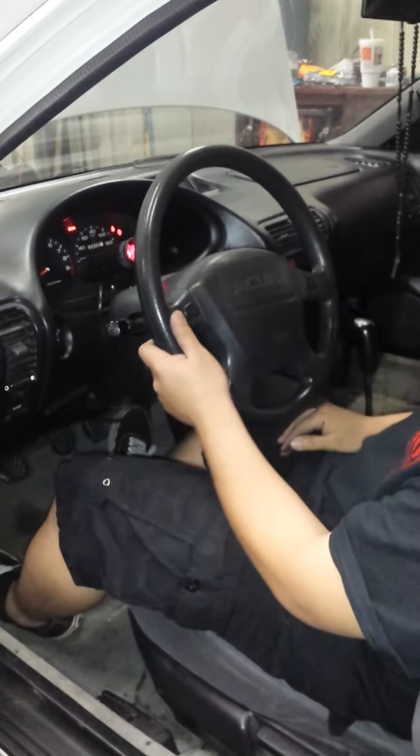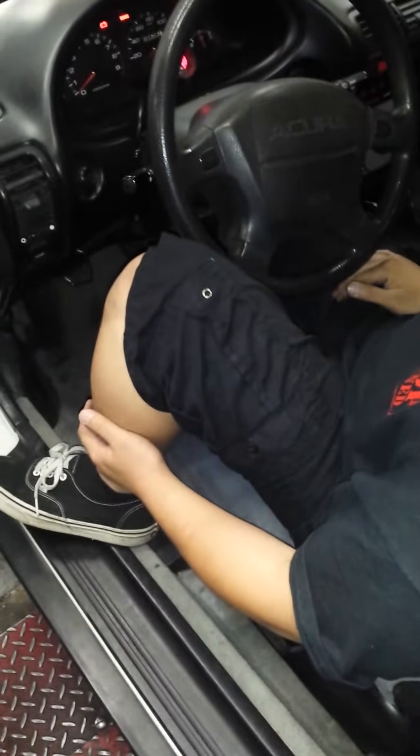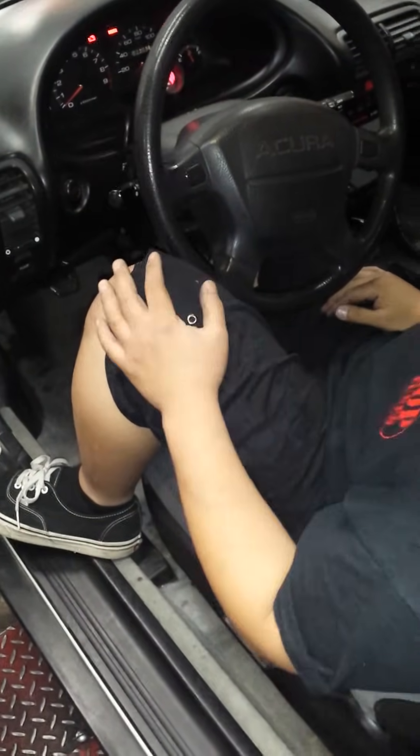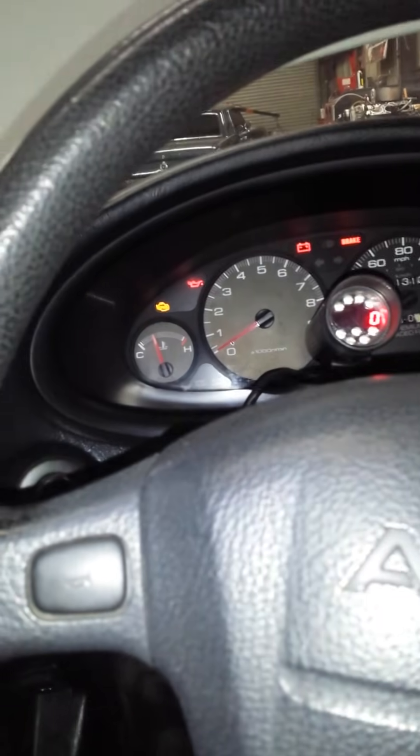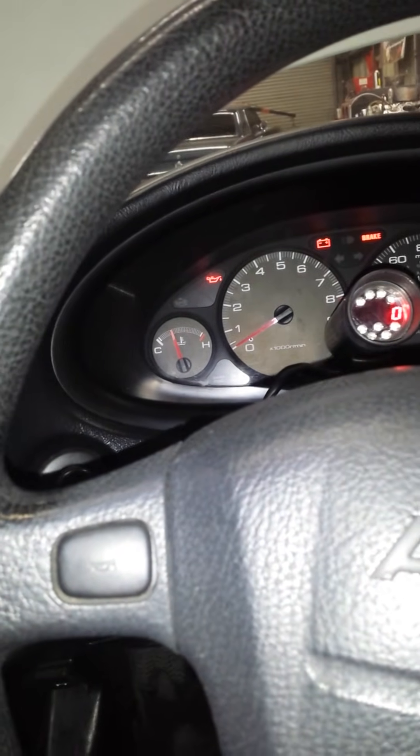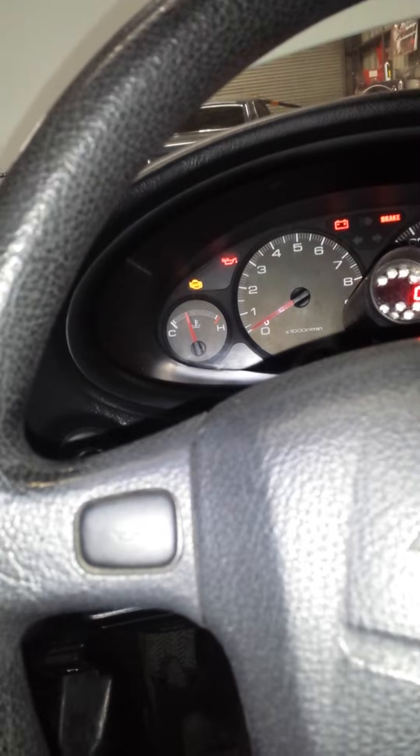There's another cool feature about Neptune. Go ahead and disconnect the IAT sensor. He disconnected the intake air temperature sensor. If you ever want to read the code, you can scroll the gas pedal and it'll start blinking back. So you no longer have to jump in. That's one long light, which is a code 10.